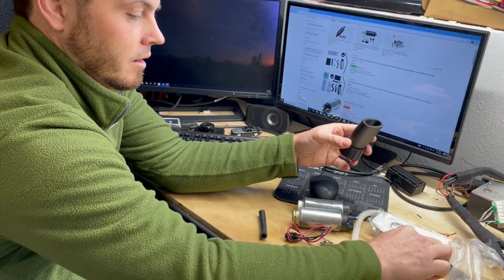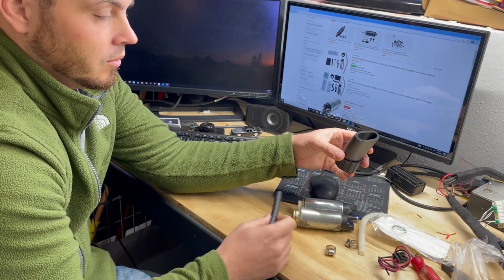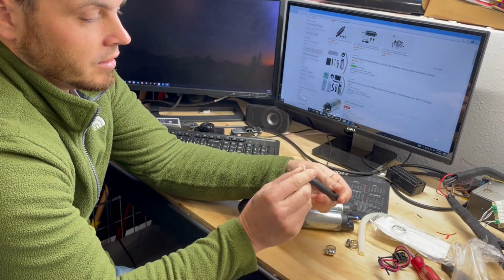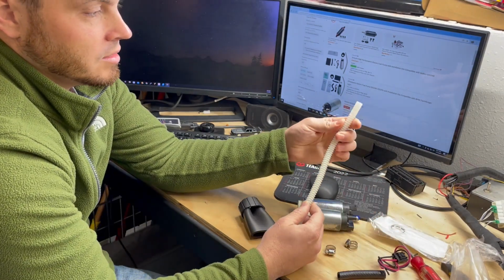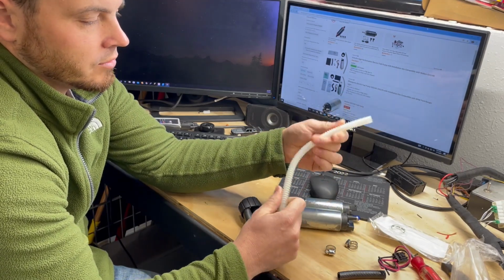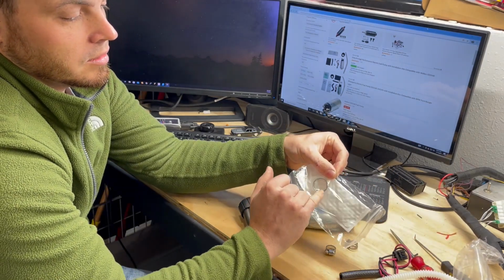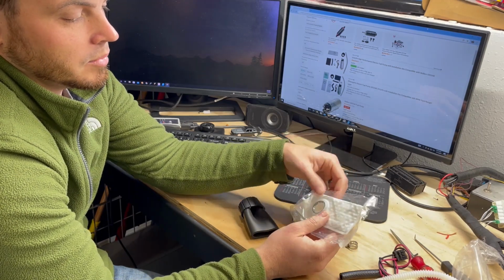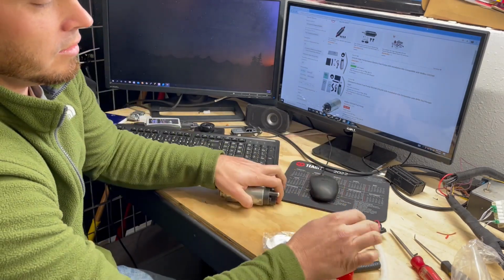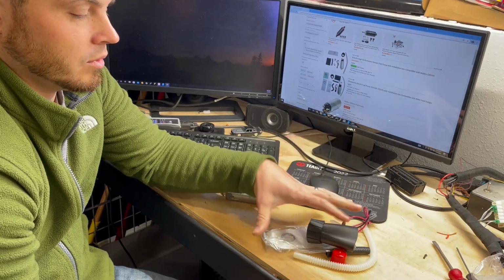In the kit we have hose clamps. We have the electrical connector, the pigtail. We have one hose right there if you want to use this shorter EFI hose. You also have the corrugated plastic hose, which is very typical. This is one we're actually going to wind up using because that's what the factory uses. And then you have the filter sock itself with the snap ring, like the compression ring that grabs the bottom of the pump. So to me, just this stuff right here was worth the $17. Just this stuff. Yeah. I feel it was worth it.